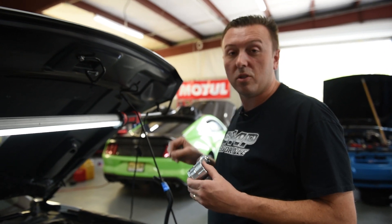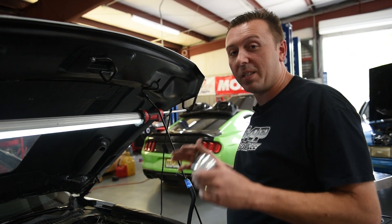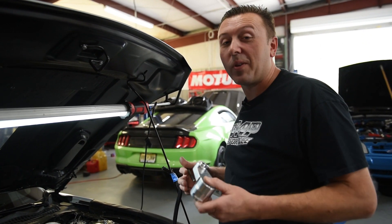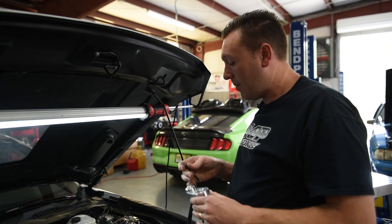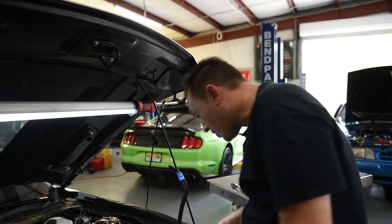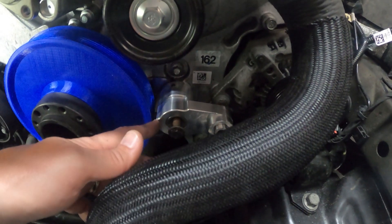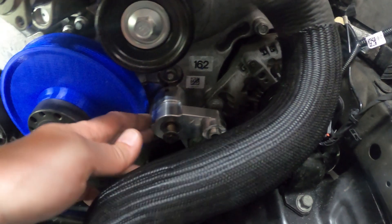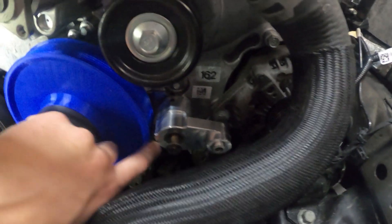You will have to drill and tap a hole on the front cover, but this is only for the 30% overdrive version. The 10 and 20% versions are totally bolt-on. The critical clearance issue is being able to slide a belt over the balancer. This is why we need the super low-profile accessory tensioner and why we drill the new hole in the front cover. The belt's about 3/16ths of an inch wide — you can see there's a big enough gap there to make that happen.